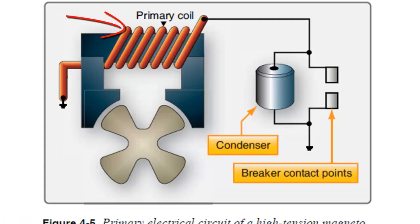We can take advantage of that by wrapping a wire around the coil core. Now as the magnetic flux builds and collapses, it induces a small voltage in the primary coil. The primary coil runs through a set of breaker points — they're just a switch that's opened and shut by a little cam that's spinning inside the magneto at the same speed as everything else. There's a condenser in parallel with the points. All it does is keep the points from burning up because they spark, so it deadens the spark on the breaker points. That's all that does.